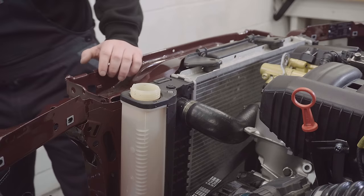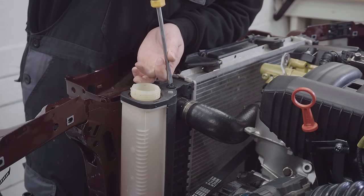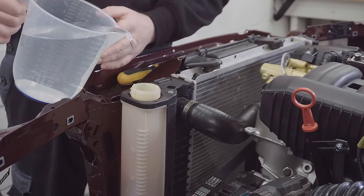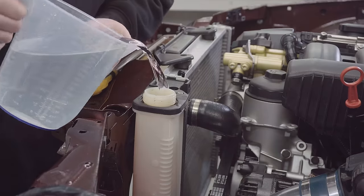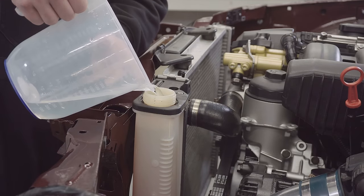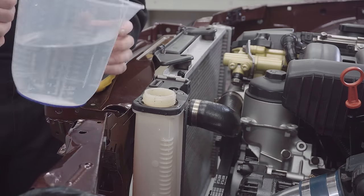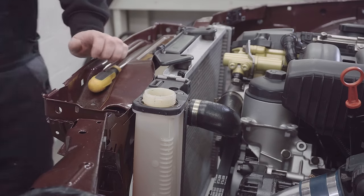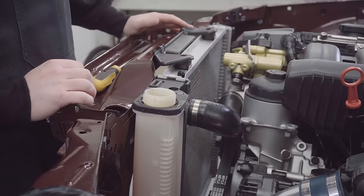Well, that's 3 litres and it's brimming. Let's open the bleeder screw so we can see if we can get some more air out before we need to start it. Well, that's about 8 now. And it doesn't seem to want to take any more, so I think I need to start the engine and get some warmth into it and get it all circulating so that I can put the rest in. Let's do that.